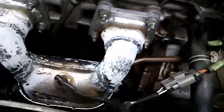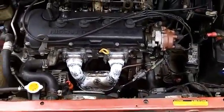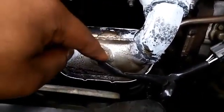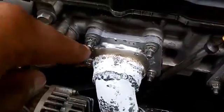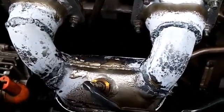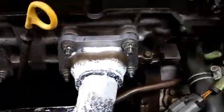On each side, that's one side, two sides. This is the overview of the vehicle, and this is up close. O2 sensor, new O2 sensor, and these are the 4 bolts per side. So altogether, up here, it's 8 bolts, down on the bottom, and these are all 12 millimeter bolts.